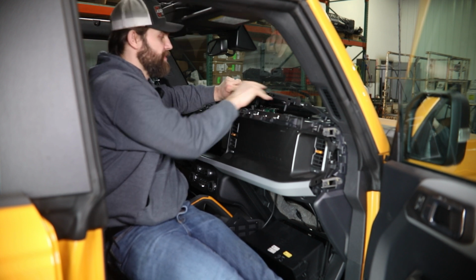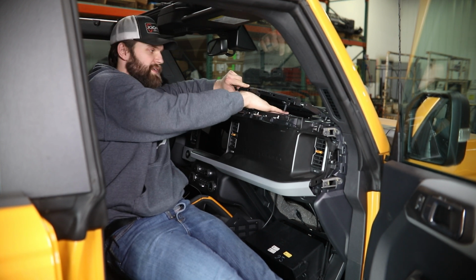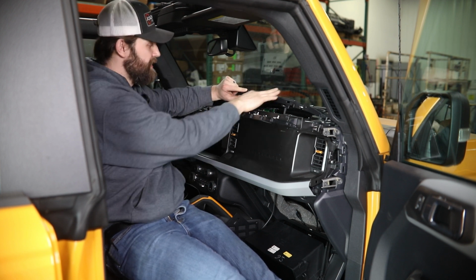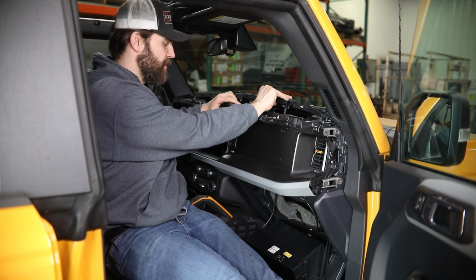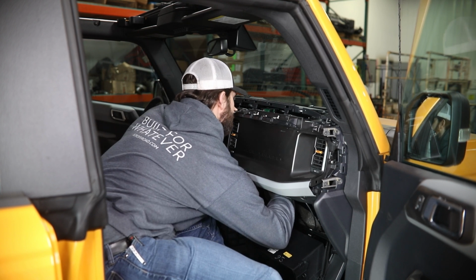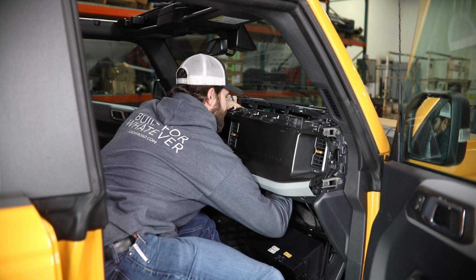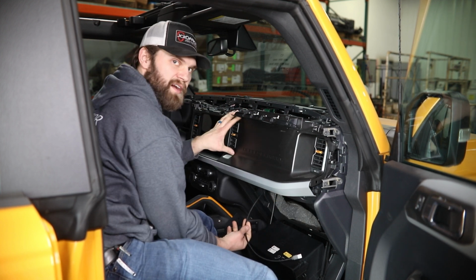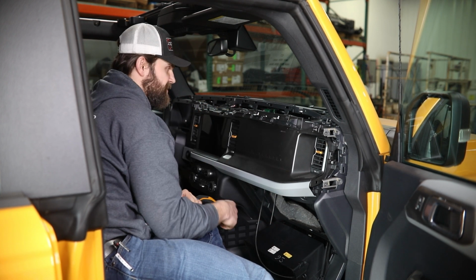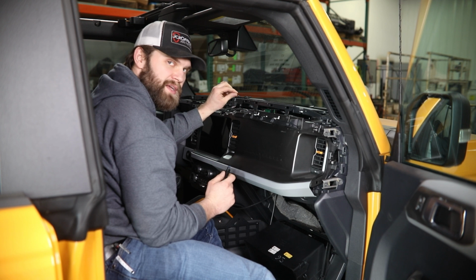And basically, as soon as you get the cable underneath through the hole in this factory panel, underneath the top cover, you're going to want to try and push this to the passenger side. So get your USB connector through and push straight over. And then reaching up through this glove box hole, you can find the cable at the same time by feeling for this air duct that runs to the vent here. So you're reaching your arm basically straight up and over just a little bit to the center of the vehicle so that you can catch the USB end of the cable as you push it across.